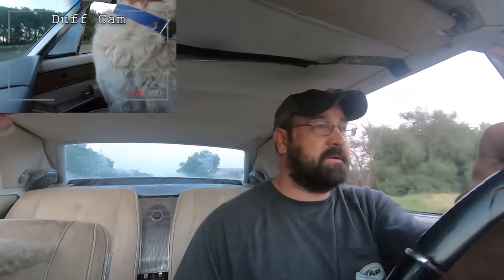This thing boogies. Stop, look at the cat. Meow. Kitty. Oh, when we floor it though, it starts running poopy. I wonder if it's just because it runs out of gas in the car. Because now she's running good again. 45. This thing just sails down the road. Ooh, there ain't a lot of fuel in that tank though. Maybe that's why it's starving. We mash it, it all goes to the back, and the boat tank ain't picking it up anymore.